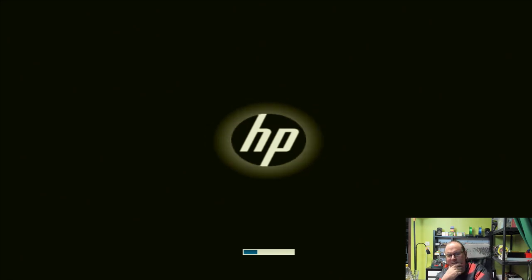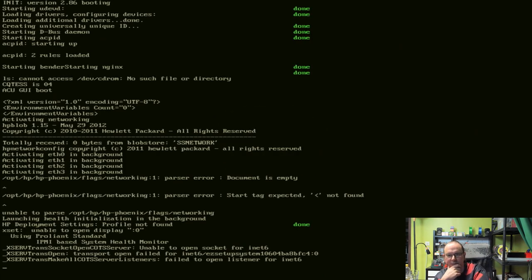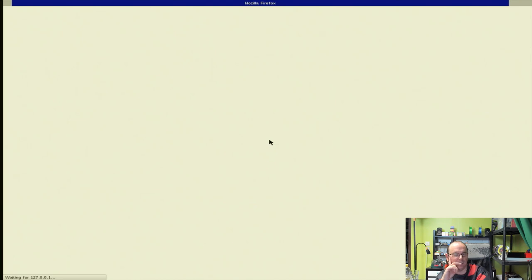The thing is that it did say press F5 to get into the low-level RAID. I have no experience of this specific HP model of this generation. But I would have expected if one pressed F5 in the BIOS menu, one would get into a low-level configuration subsystem to be able to just say, okay, make one logical block of the whole thing and use RAID 5.